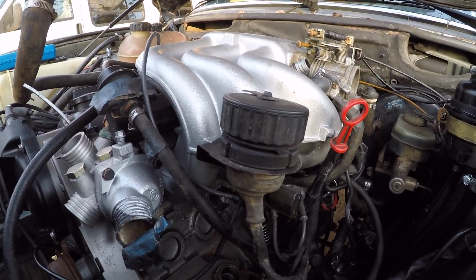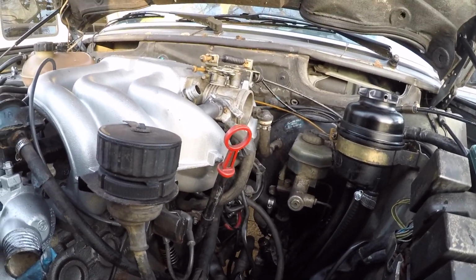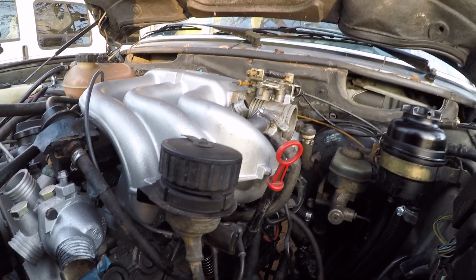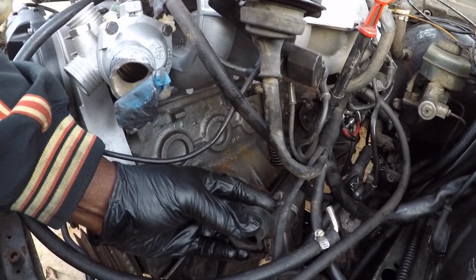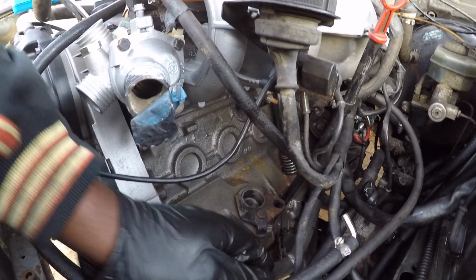But I am getting excited because for the most part, most of the critical things that I'm seeing that need to be connected, I have an idea how to connect them, and some of them are already connected. I have two issues. I want to change this hose. I don't think I bought this hose for the heater hose. I have to double check. I got to replace it because you see there's a big rip here right underneath the thing that's going to leak out coolant, and I don't want that.